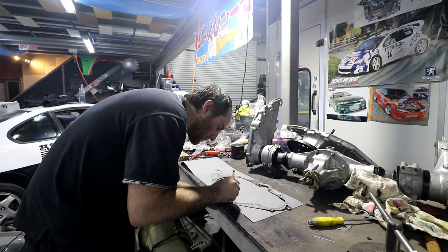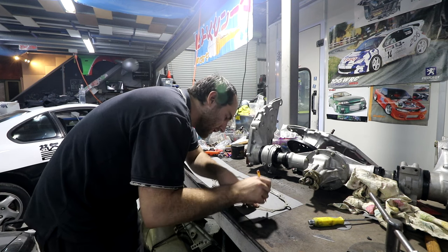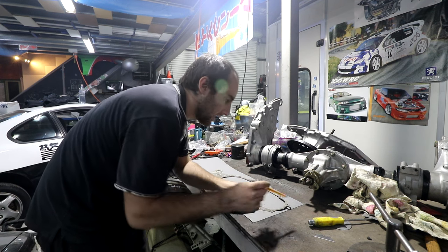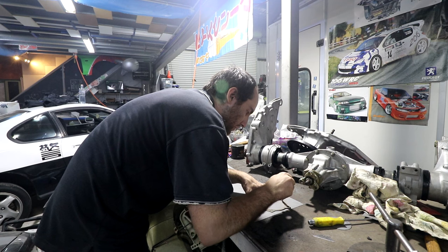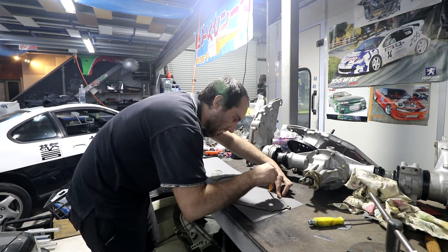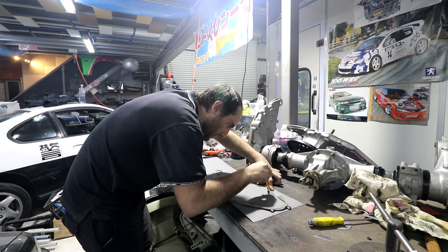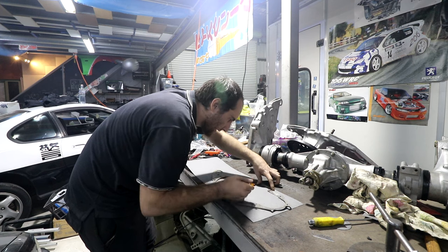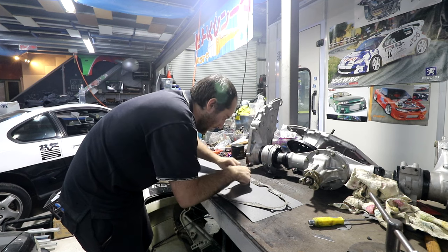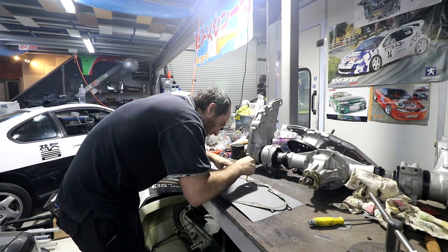Just. I should really make a laser cut file for this gasket, save me ever having to do this again. But it's a bit of a weird shape. The gasket that I cut out for the end of the chain case, I just measured with a pair of verniers and drew it on the computer. What I would do for this one is take a photo of it, scale it in the computer, and trace over the photo. But what I would like to do is 3D scan the chain case and then design a gasket from that. I do have a 3D scanning video on my channel already with a little 3D scanner that I bought. It's not really supposed to be a 3D scanner, it's something I sort of bodged to work as a 3D scanner.